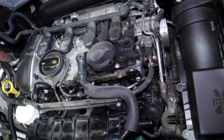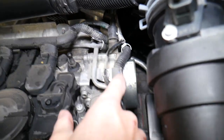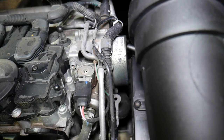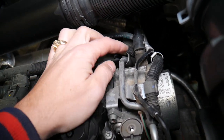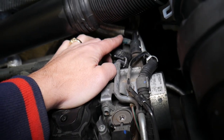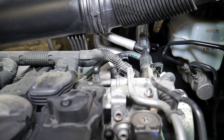Let me show you where that pump is located. If you look at the engine, this is your intake side and this is your exhaust side. Your exhaust camshaft will be on this side. Right here on the exhaust camshaft — that thing on the side — this is your brake vacuum pump. You can see it attaches right here to the valve cover. This is where it builds vacuum. If yours is not working, always make sure this hose is good and that you don't have a vacuum leak. From here you can see it goes all the way to the brake booster — that's the hose that goes to the brake booster. This is a weak spot; sometimes it breaks there and you may have a leak, so always check that.